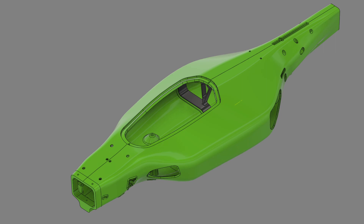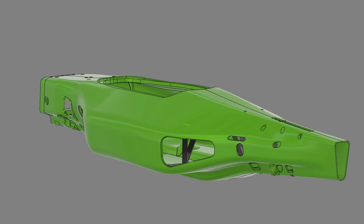Because the monocoque is integral to all of these different components, I found the design of the monocoque needed to be very flexible. Any changes to the suspension, aerodynamics, body, or internal components of the car ended up affecting the monocoque. So it's best to have a really solid design and label everything so you can go back and edit it later. 3D printed monocoques are a bit unique in that the materials they're made of are non-isotropic, meaning the layer lines of the 3D print make the shell much weaker, so the design has to account for this.